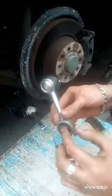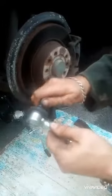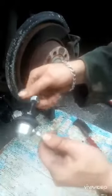This is our new drop link. As you can see, there's a new bushing in the bottom part which goes onto our rear anti-roll bar, and the top — not as much play in it. Don't be worried if there's a little bit of movement in it because it's supposed to move slightly. We're going to insert the drop link into the top part first, placing it through the hole.